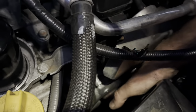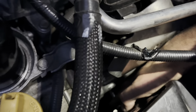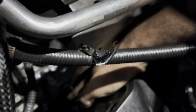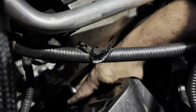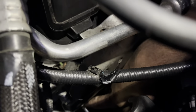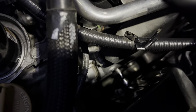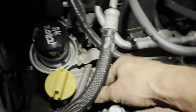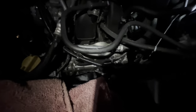There's the extension right there — and it won't come out. You can see it won't come out; it's hitting the battery box or the frame. Even with the battery box out, it's still going to hit the frame. What I have to do is get the extension off the socket — that's what I use the screwdriver for. I reach the screwdriver in there, pop it off, pull the extension out, then I can pull the socket out by sticking my pinky in there and grabbing it.